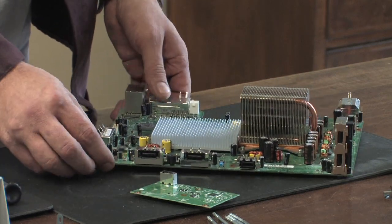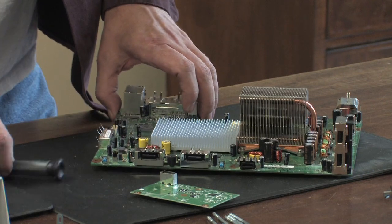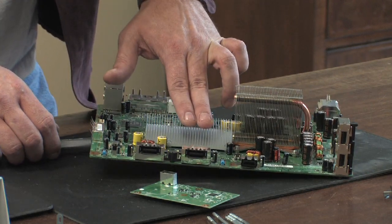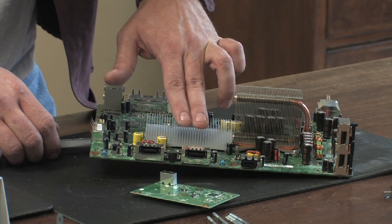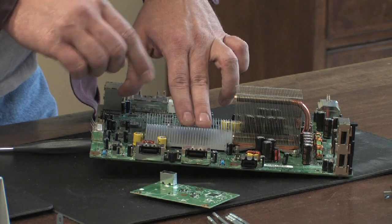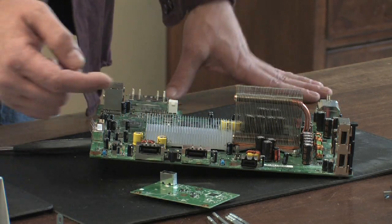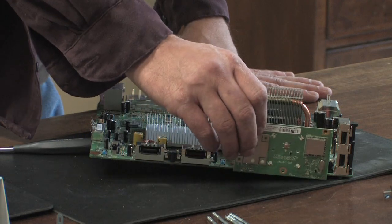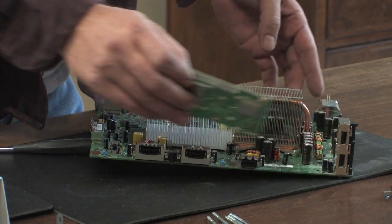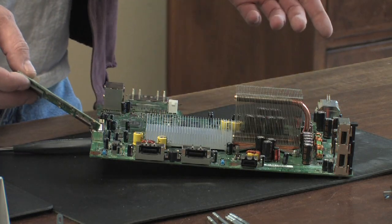Because if you have it down, it'll actually push the heat sink up too far away from the GPU. Just prop something under it and push down evenly — not hard, just enough for the heat sink and the heat paste to actually make a seal on the top of the GPU. After that, turn the unit on again, put your on-button back on, plug your power and your video in, turn it on, and your Xbox should come up with no problem.